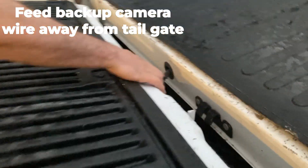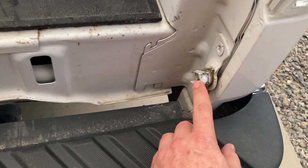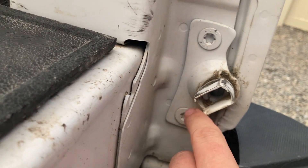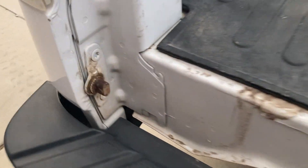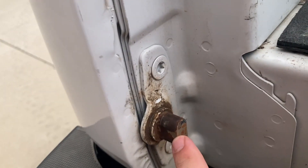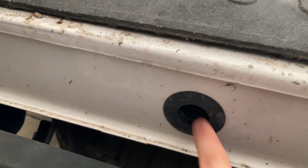Next we want to disconnect our backup camera — we'll show you how to do that from underneath and then feed it up through here. We've got the tailgate here. The right-hand side fits in at a 45-degree angle — see it right there. The left-hand side is an 80-degree angle. To attach it, we'll put the left side in first, then slide in the right-hand side at the 45, and then attach the backup camera through here — we'll show you that in just a minute.